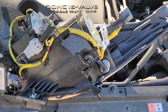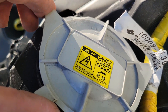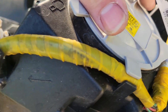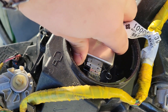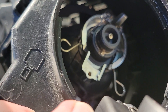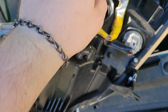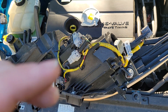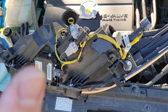Once you've done that, you can take a look here — this is the door to access the headlight bulb itself. All you have to do is read the directions on it, twist it in the direction that says open, and it'll pop out. Once you get in there, you'll see the connector from the ballast to the bulb. Just twist it and it pops right off. The bulb is held in by two little wire clips — pop those out and you can remove the bulb. When you do, hold it by the base and do not touch the glass, as the body oils on your fingers can heat up when the bulb is running and potentially cause the bulb to explode.